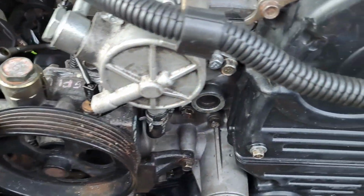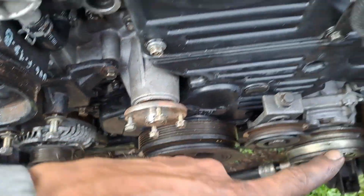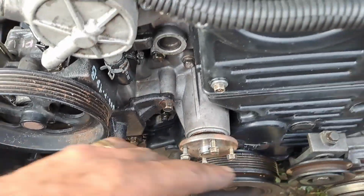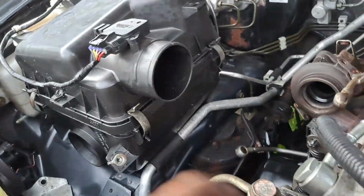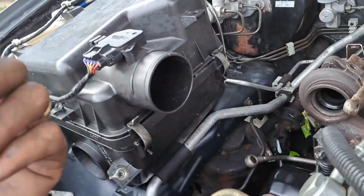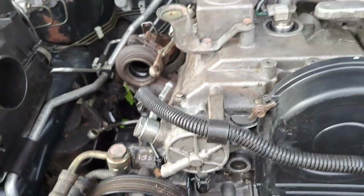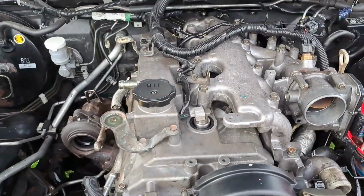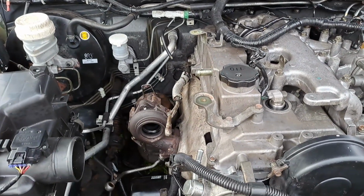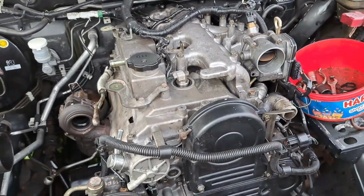All the front's been done. I've just got to stick your propeller on for your fan, stick your brand new belts on, and then that's the front done. I've just got to take your air box off, flush your header tank through, and obviously flush your radiator through as well, mate. So yeah, I had a good day today. It's all going well, mate. So fingers crossed. Hopefully I'll see you soon, brother.